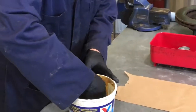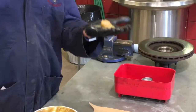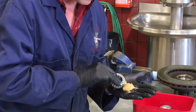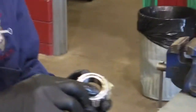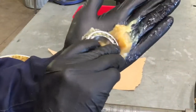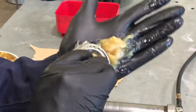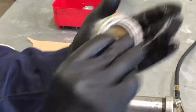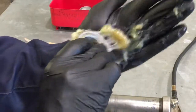When repacking the bearing, put a dollop of grease in the palm of your hand — I'm using nitrile gloves here. Take the bearing with the tapered part upwards and tip the bearing edge into the grease, keep dipping it until you see grease tailings coming up the edge of the bearing. Continue to walk around that bearing until the tailings push all the way out. Many times I see people just trying to smear grease around the outside of bearings — the bearing will not be properly packed and you'll have bearing failure. This has got to last thousands of miles, so make sure grease gets inside. You can see most of the grease that was in the palm of my hand has gone into the actual bearing.